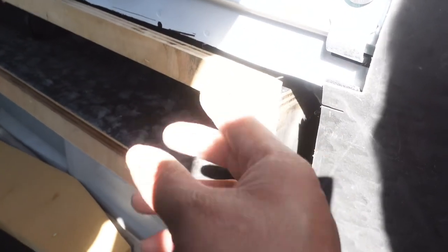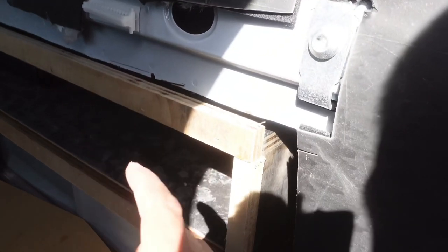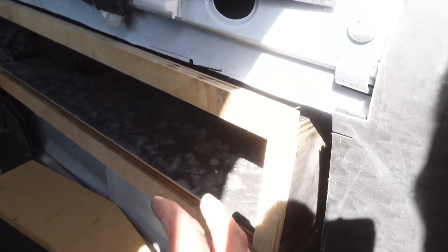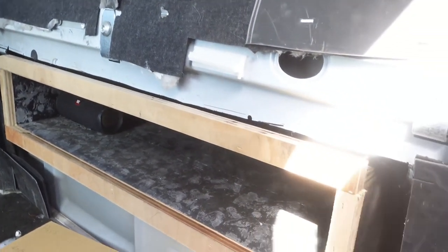We just cut strips out and stapled them, and it actually gives us a lip to screw into when it gets mounted, versus it just going into the port and splitting the wood along the way — so it's actually pretty good. Now all we have to do is cut a piece side to side, width wise and height. Once it sits pretty good we're going to trace out a rough draft hole, cut the bulk of it out, screw it to the actual port, then come in with the router and flush router it out so it's dead-on perfect. It's going to serve its purpose — not let any pressure go back into the sides — and it'll be open enough so we can still pass our zero gauge, our RCA, speaker wire, whatever we need to run from the bed inside the cab.